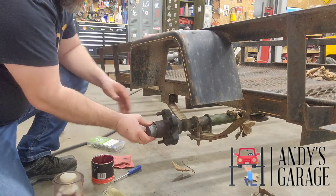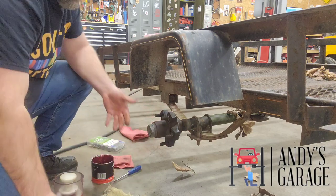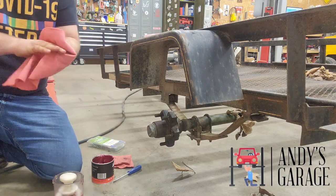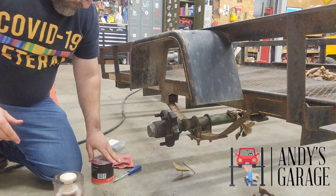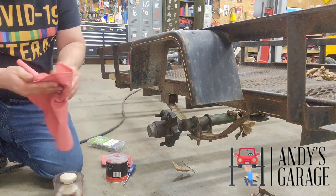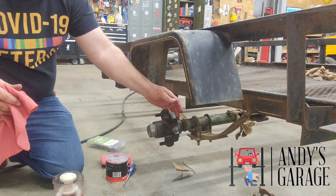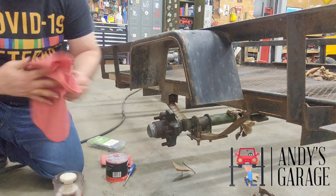Now that all that's done, I'm just going to put the dust cap back on. You don't have to get that dust cap on hard — just tap it because it's already kind of banged up just from being used. That's real thin metal and you can deform it real quick. Always make sure you put your dust cap back on — you do not want those bearings exposed to the elements. Because this rear seal helps keep a lot of moisture and things like that out from the backside, and this is what helps seal it from the outer side.